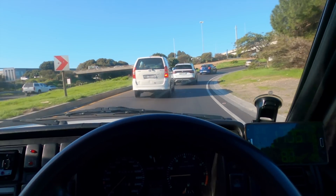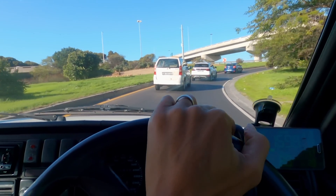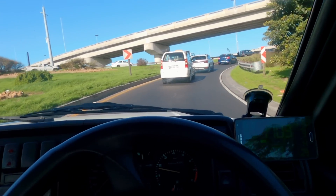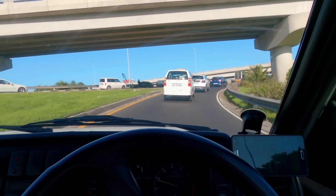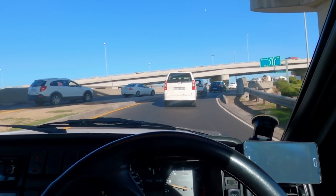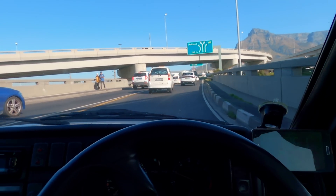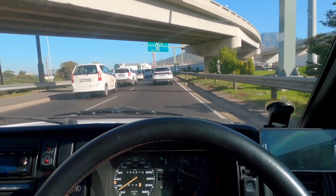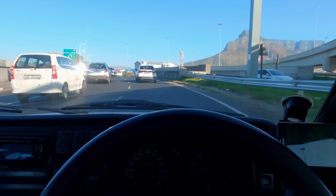At the moment the boost is around 1.9, nearly 2 bar, and as you can see the car is breaking up. Hopefully I'll be able to see some action on the dyno — if not today, then hopefully soon. My ethanol content is like 40%, so we won't get to see a clean power increase from the water meth. But at least I won't be ethanol dependent when I race — I can just run the car on pump fuel with water meth, which would be really good. There's a massive 10.5-litre tank for the water meth — it's a big boy.